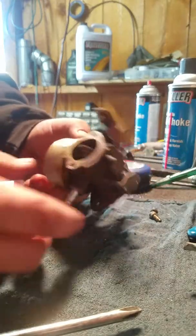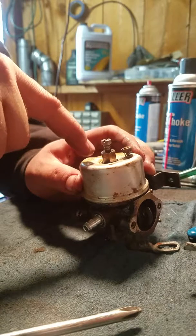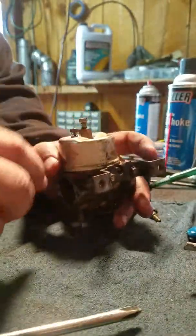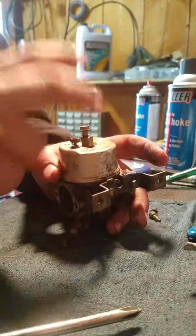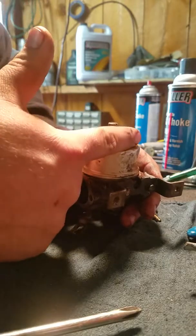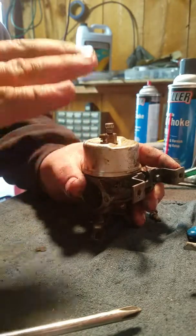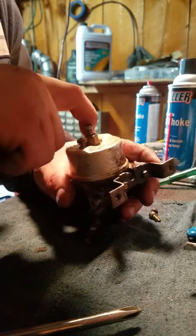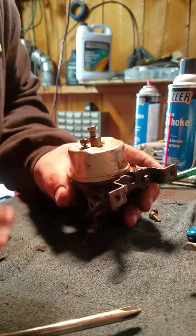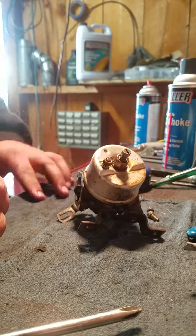Next I'm going to pull the main screw right here — plus your jet is right here, and this also holds your bowl on. Now the Tecumseh videos — in that one other video I mentioned they have a special bowl that goes on a certain way. It's because the float travels through here and this is where your float pin goes in, on the flat part. So you need this extra bowl space to allow that float to travel. I'm hoping that's not a rot hole, because these aluminum bowls are known — the gas will eat right through them.